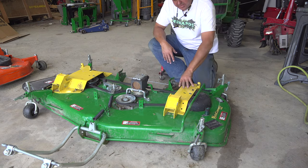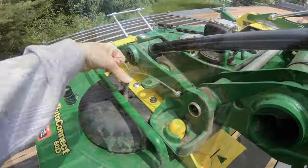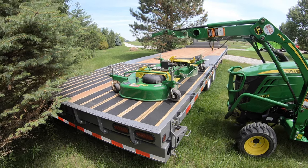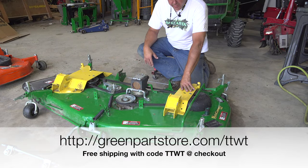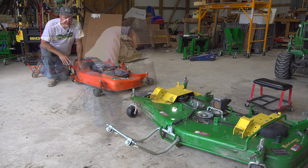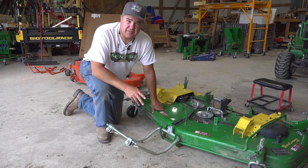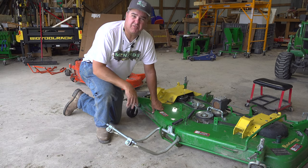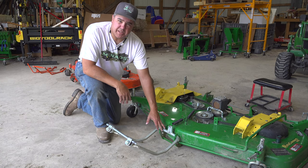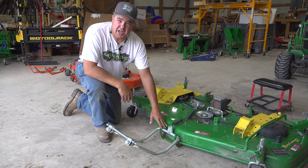We should take a minute to talk about the load and go. It is $250 extra, but it's a tremendous feature. With your John Deere quick attach loader, you can slide your quick attach right in there and pick it up — it's something not available on any competitive brand that I know of. The BX deck has a nice center roller, which really helps to prevent scalping. The Deere deck does not — it's got a skid plate. I've shown putting a roller on my 54-inch Deere deck in my video history, but this one's made a little differently, making installing a roller slightly more complex. Presumably the center roller was left out because of the auto connect deck and that little bit of slippage when you uninstall or install. A center roller really helps, so that's a nice BX feature that's missing on the Deere.